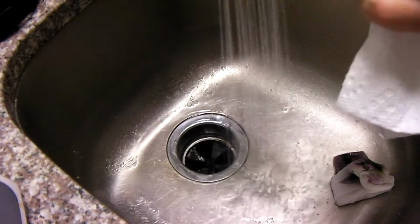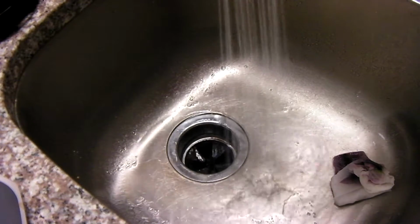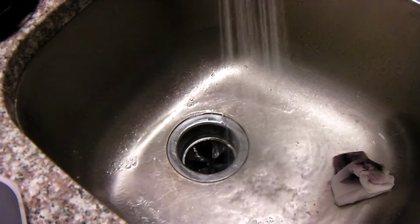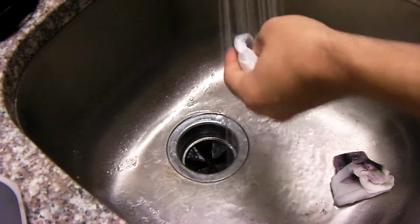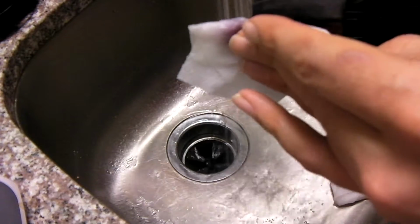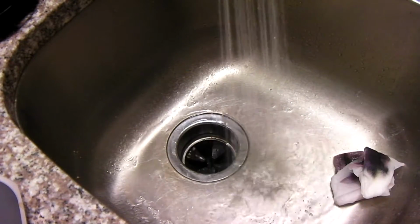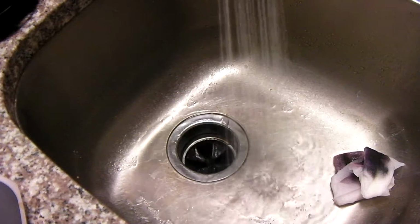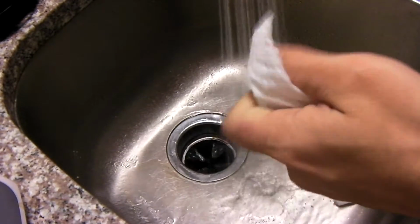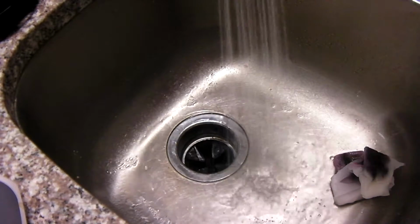Like I say, these print heads, HP wants a pretty penny for them, so if you have one that's not working right, this very well could fix your problem. I mean, there's a load of ink coming out of there. I'm going to tell you, these things, they don't do a very good job of actually cleaning themselves. And really, to be honest, the printer clean function you may find in the maintenance section of your printer is something that really the printer does kind of on its own, just to a lesser extent.